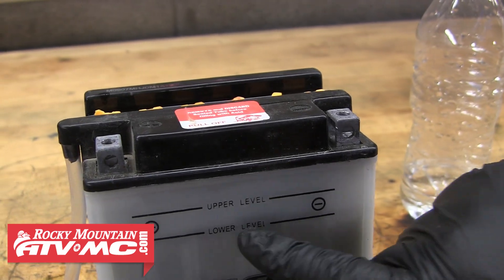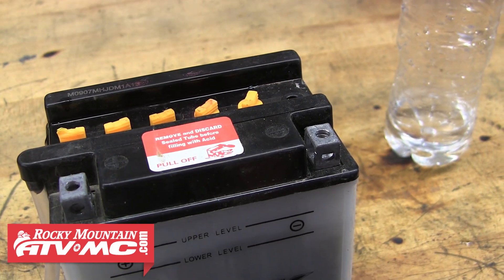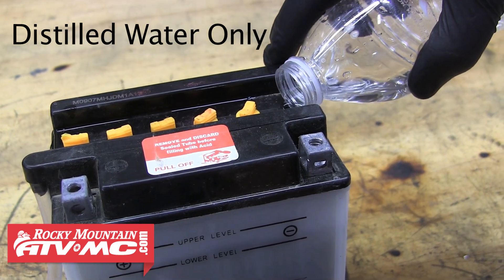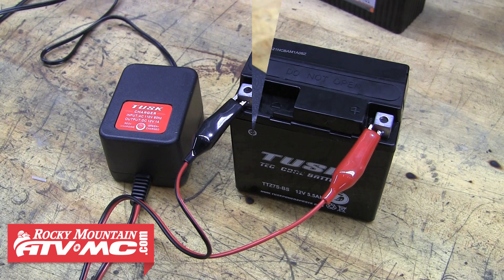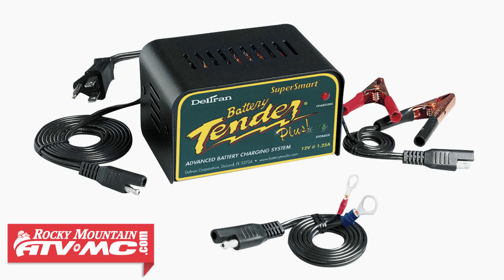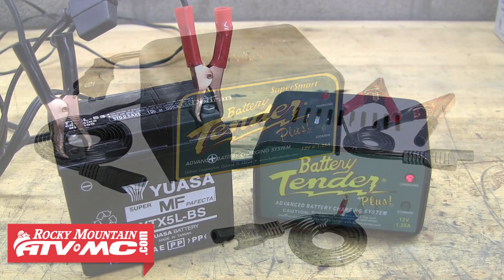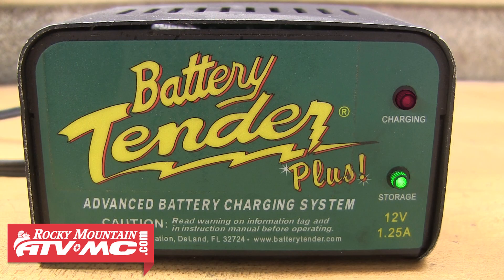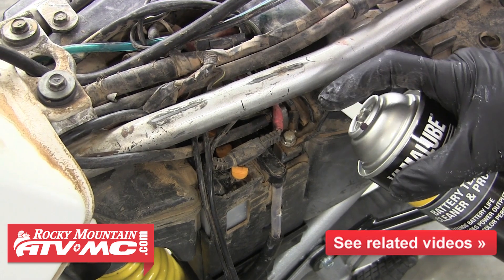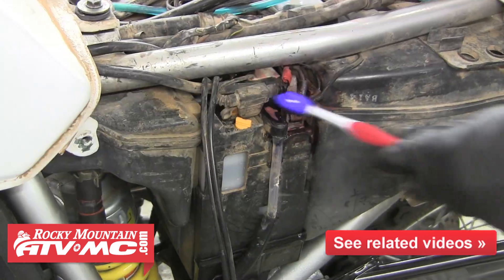For conventional lead-acid type batteries, anytime you're charging you need to watch the electrolyte levels. If it falls below the specified level in any one of the cells, use only distilled water to bring the level back up to the correct height. After a few hours, the light will turn green indicating the battery is fully charged and the charger will automatically shut off. Having a battery undercharged can harm the battery and shorten its life — the same goes for overcharging. If you're using a smart charger such as the Deltran Battery Tender, after the battery reaches 100% charge it moves into float mode, holding the battery at full charge without overcharging it. If the battery drops below 100%, the tender will kick on and bring it back up to full. For more information on battery chargers and properly maintaining your battery, refer to our battery maintenance video.